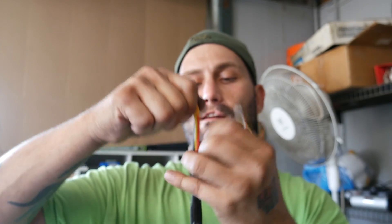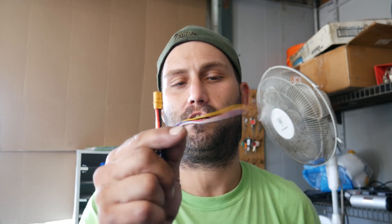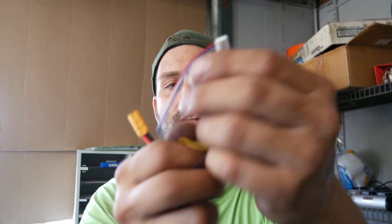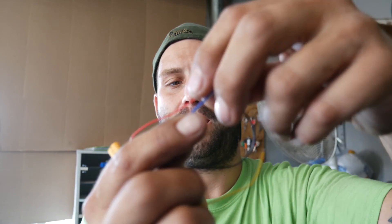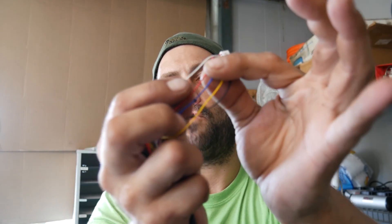This is your phase wiring — that's your three wires, where you're gonna have electricity coming in from your ESC or VESC or whatever you're using. And this is your hall sensor wires here. You're gonna have a negative, a positive, and then black on one end, red on the other end. And in the middle, your yellow, white, and blue. They're for the three hall sensors or pickups inside of the motor.